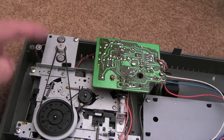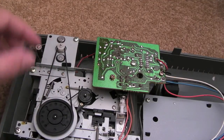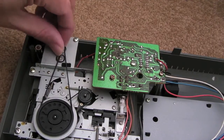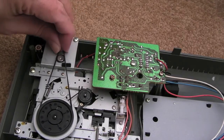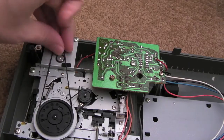Ultimately, the motor of the tape drive here was the problem. As you can see, there's no way you can get the motor to move at all — it's almost like it feels jammed. It's like one of the brushes inside is damaged or something on the commutator. I've tried using a bit of lubrication on it, got it working, it was playing for a bit, but ultimately it just jams again.